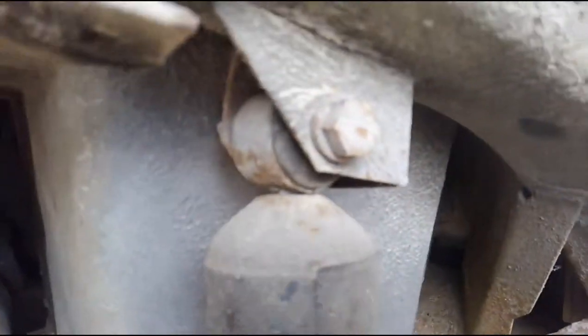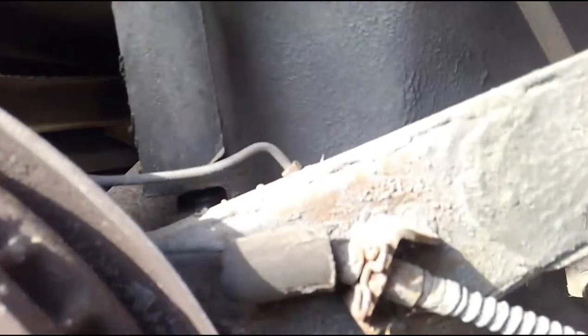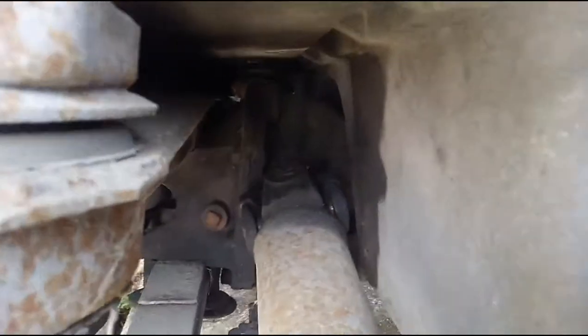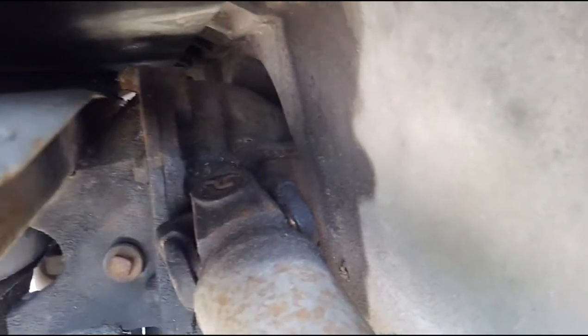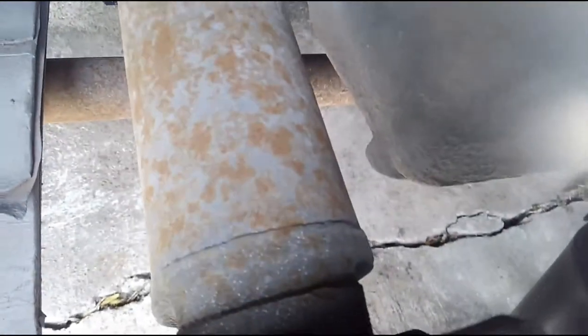It's a metal housing but old — the bushing actually looks pretty good, but it's probably at least 15 years old. They're not supposed to have that gap in the middle there, so we'll change these out and see if this girl rides a little bit better. You can also see here — maybe I've never detailed this before — the independent rear suspension on Corvettes: the half shaft and the center differential where your ring and pinion is kept, with a half shaft that spins while the car is in motion.